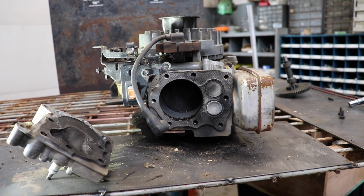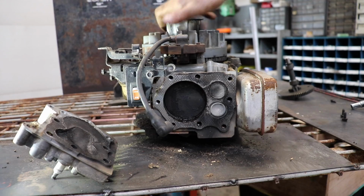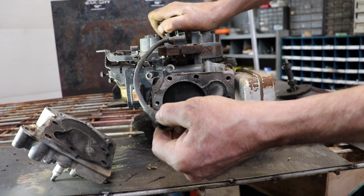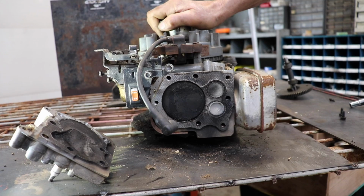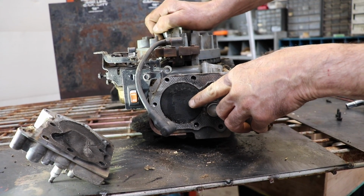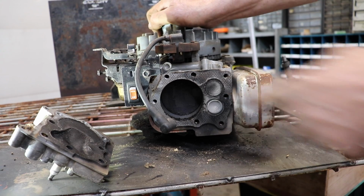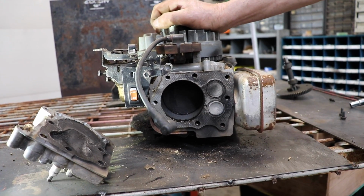So that's our third stroke, power. You understand that now? As the piston's coming up, the coil sparks the plug, setting off that small explosion, and this all happens in a split second as this is traveling up, and then just as it's starting to go back down, that explosion forces the piston back down. And again, both valves are closed.